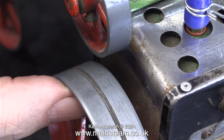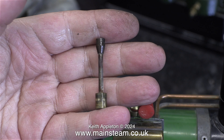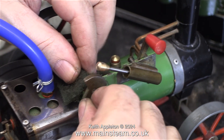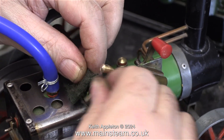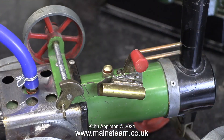This is a very old engine and as such has some rust problems. In this close-up you can clearly see how dirty the flywheel is — I'll remove all this dirt, grime, and some of the rust later. This is the piston and connecting rod in my hand; it's not only rusty, it's badly tarnished. Just like I did with the safety valve, I put it in the lathe chuck, spun it, and cleaned it using some Scotch-Brite. Now it's clean and the piston and rod, which is very visible on this engine, looks a whole lot better.